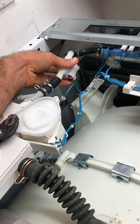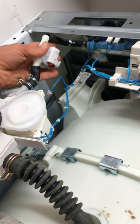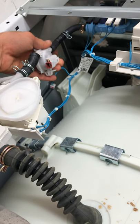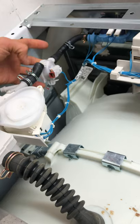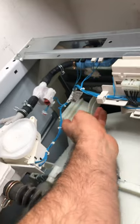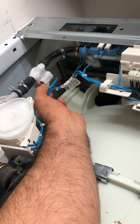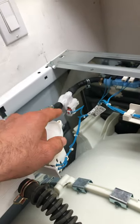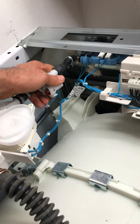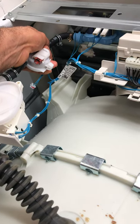The proper way to clean this — it's located here. It goes on in that position, and this hose goes between the soap dispenser and the water valve. It sets like that, and there are two clamps that clamp. This clamp goes and sits there in that position, and this wire also connects into it just like that. If it gets dirty — full of dust, calcium build-up — you get error code FH.